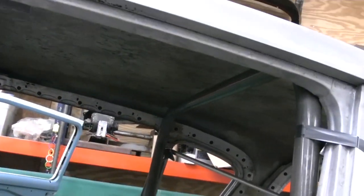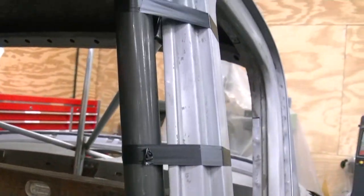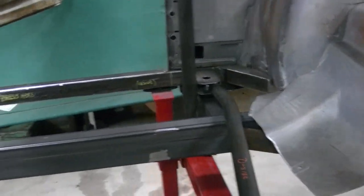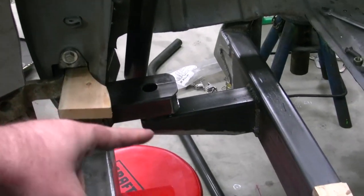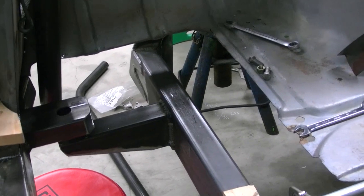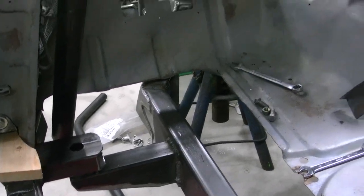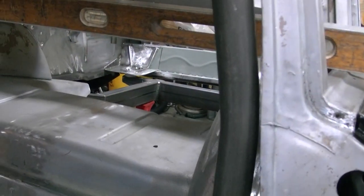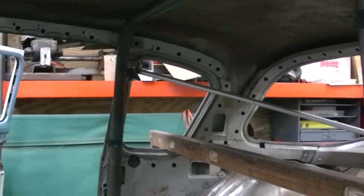We're in the very early stages of just laying up the roll cage, trying to figure out where things will go. This is the main hoop back here — just have it kind of sitting in place. It'll clear our mounts by a little bit but not a lot. Up here we're thinking about bending the A-pillar to where it comes on this side of the mount, so we can weld all the main bars inside the car and still get the body off with the frame. We'll keep the roll cage welded to the frame and put in the front tubes and dash bar after the rest of the car is done, as well as the down tubes back here.